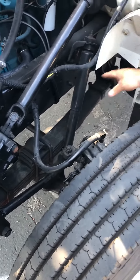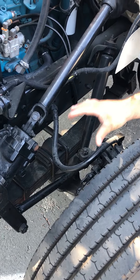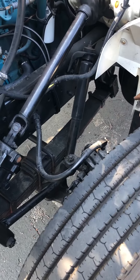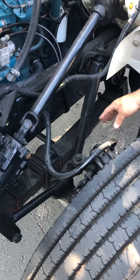From there, I'm going to move on to my suspension. I have both spring hangers — they're secured to the frame of my vehicle and in good condition. My leaf springs: I have no more than a quarter of them broken or missing. My keepers are in place and my shackles are in good condition — metal, not bent, cracked, or damaged. Everything's properly secured to the axle of my truck with its proper hardware.